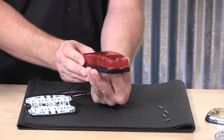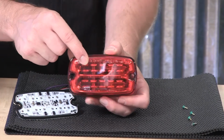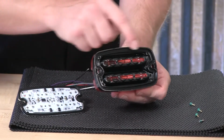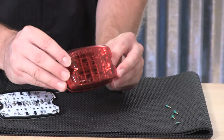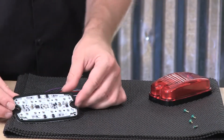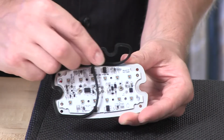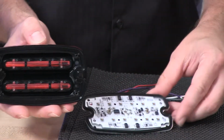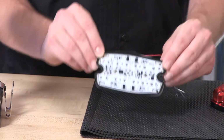So front curved polycarbonate lens, and inside that, Whelen has added an additional polished reflector assembly. Those 2 pieces are then fused into the black polycarbonate backing piece here. So a nice, tight, sealed up product with all these being fused together. On the light head itself, an internal sealing gasket helps to seat the lensing against the electronic board. So you can actually see there's a bit of a lip all the way around the light head lens, and that is where this gasket will seal into.